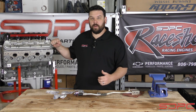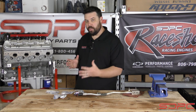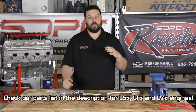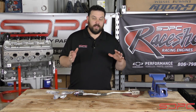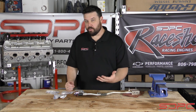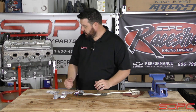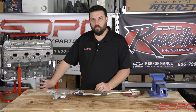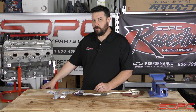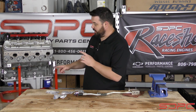We'll be talking about Gen 3 and Gen 4 LS, but we'll also be talking about Gen 5 LT. I wanted to have one here to show you, but unfortunately we don't have any right now. It's a very simple concept and a very simple way to delete these oil cooler systems. A lot of you probably bought a junkyard truck engine, and even some of the LT crate engines will have them. The LTs will have a big finned brick on the driver side lower of the engine, near the oil filter or oil pan area — kind of in the same spot I'm pointing to on the LS.